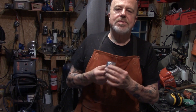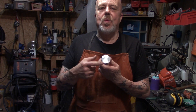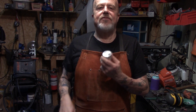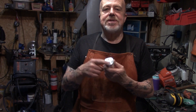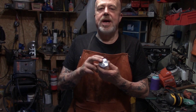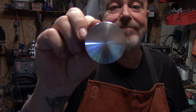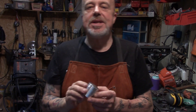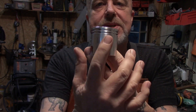Welcome everyone, Eugene Hughes Motorized. There's always a lot of questions and comments about which direction the arrow on the piston faces. Well, it faces in whatever direction it wants — I've seen them stamped both ways. And take a look at this piston right here — there's no arrow. So bottom line, what you need to do is look right here, on the intake side of the piston.